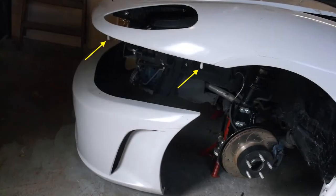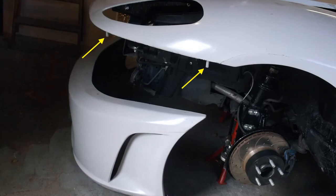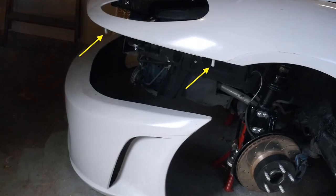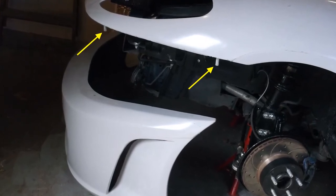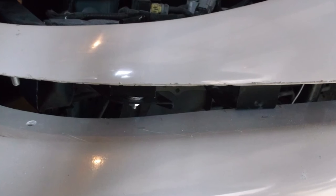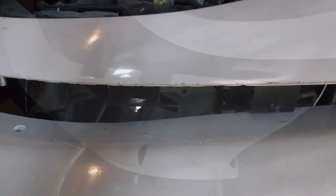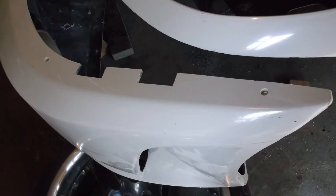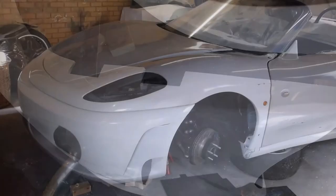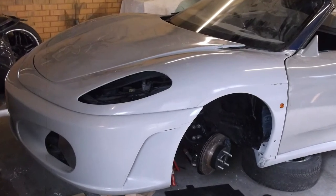Time to mount the front bumper for the first time. The supplied front clip has a couple of threads hanging through the bottom, as shown by these arrows. You need to cut out some holes in the front bumper which are indented — they are kind of marked. Here you can see the holes have now been drilled. I also noticed I would need to cut out a couple of slots to get around the headlight bracket. Then the front bumper could be fitted — and wow, it just changes the whole shape of the car, it looks amazing.